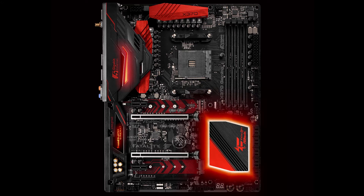For internal I/O, ASRock has two USB 3.1 Gen 1 headers on the right side of the board, just below the 24-pin connector. And there are 10 — yes, I said 10 — SATA 3 ports. However, only 8 of these are RAID 0/1/10 compatible. Sadly, there is no U.2 connector on this board.